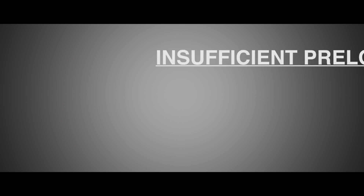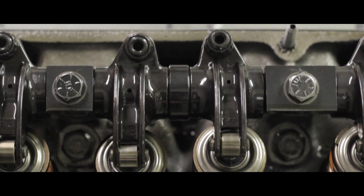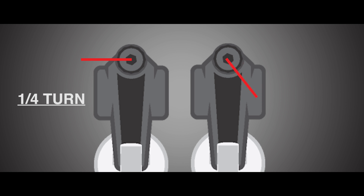After doing all this, do you still find the valve train chatter a bit excessive? The correct amount of lifter preload is important to help efficiently control the valve train. Insufficient preload will cause valve train noise, while too much preload may damage the hydraulics of the lifter, cause low manifold vacuum and rob power. We suggest lifter preload should be set a quarter to a half turn of the wrench on the rocker arm adjusting nut, past zero lash for optimal performance.